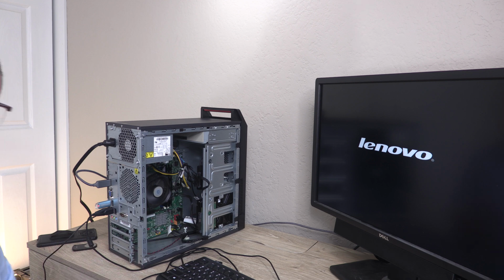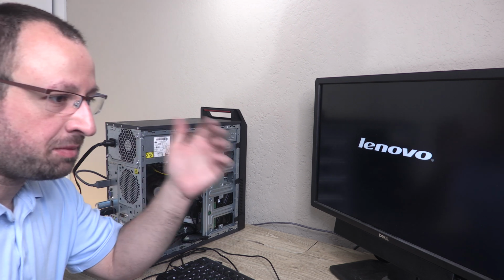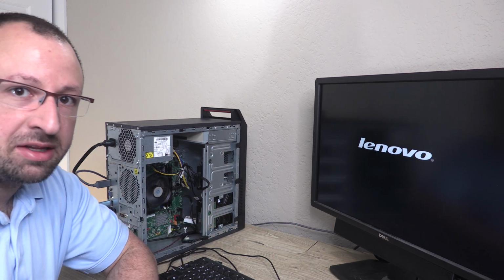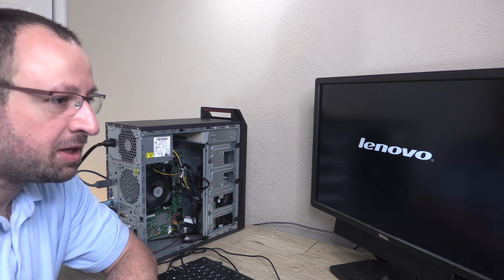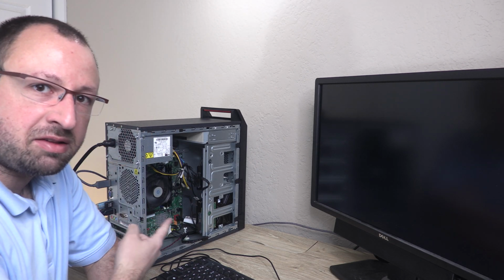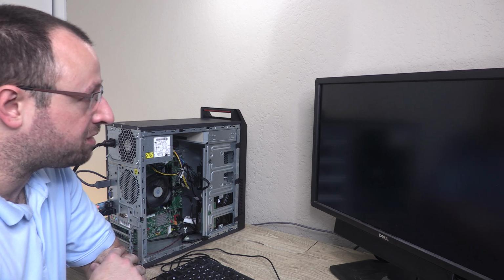And again, every desktop that you have is going to be a little bit different. Some are going to automatically detect it there. Others you're going to have to go through a couple of steps like this. But the important first step, if nothing is working the way you expect it to, is to enter the BIOS. The license should be stored in the BIOS, and that started with the first gen Core series processors.